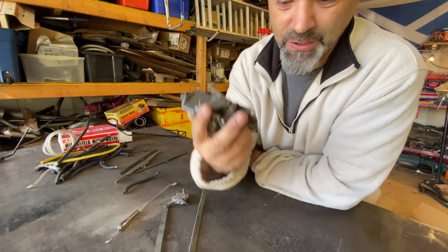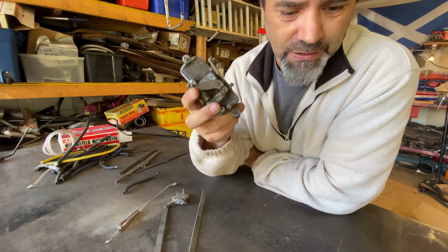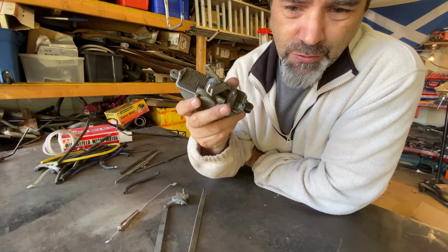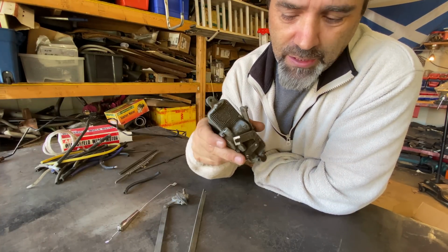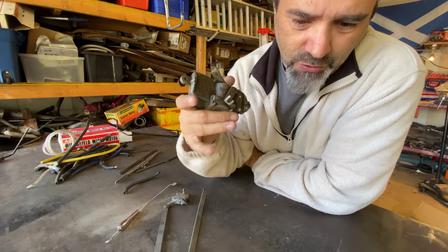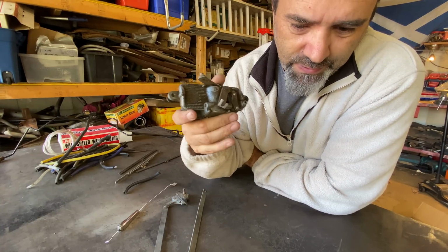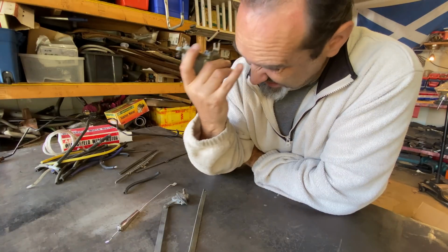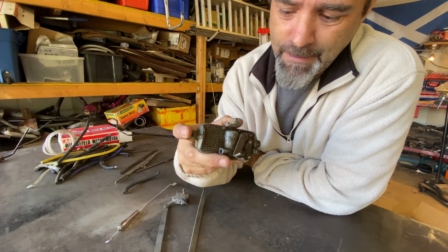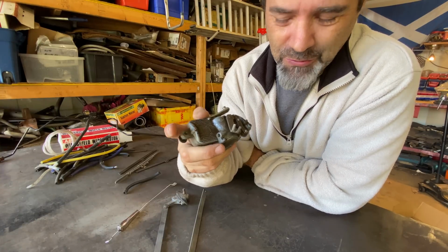Now, obviously, because it's vacuum powered, it will take a feed off the manifold. But it means that it's only actually going to work at idle or very low RPM. Because when you're revving up your car, the vacuum's gone, it's going straight into the engine. The carb is open, so it is known to be a bit of a pain when you're driving up a hill in the rain, you're putting your foot down, no wipers.